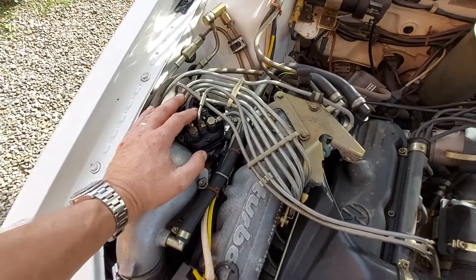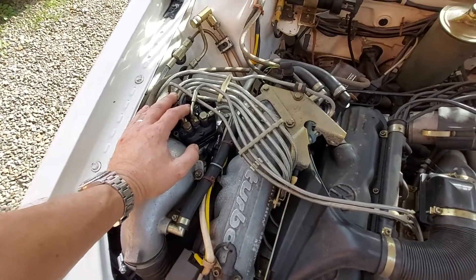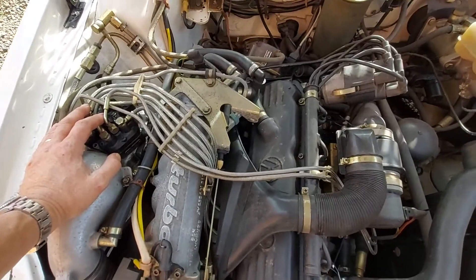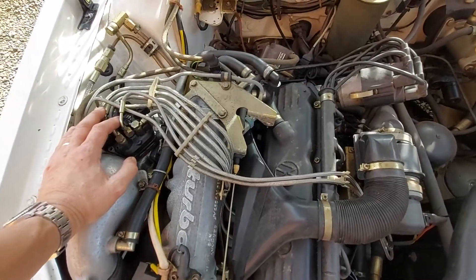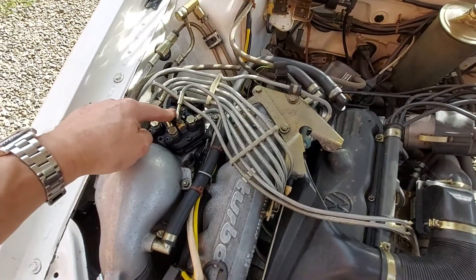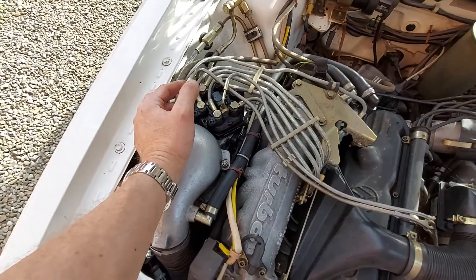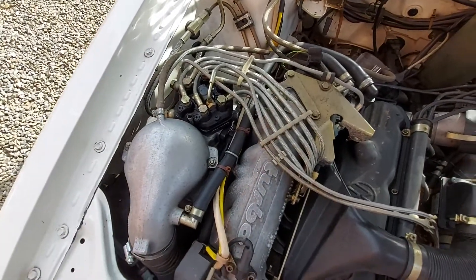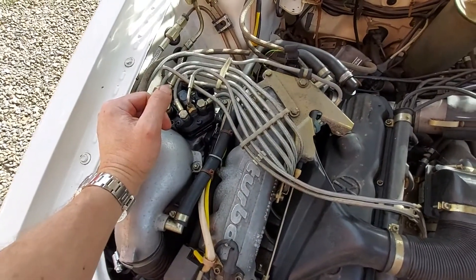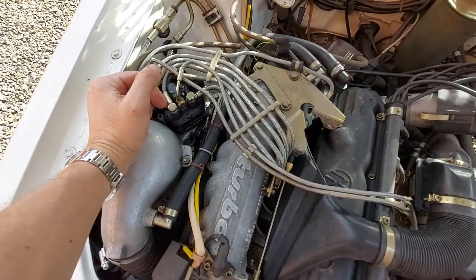It's very important that the fuel pressure is right on this engine. I've done it myself many times where I've had an engine running a little bit ropey, changed the spark plugs, dizzy cap, spark leads and gone down that route, when actually the problem was too much fuel pressure. So I bought myself a fuel pressure test kit from America, and in my next video I'm going to fit that onto the car and show you how to check your fuel pressure.